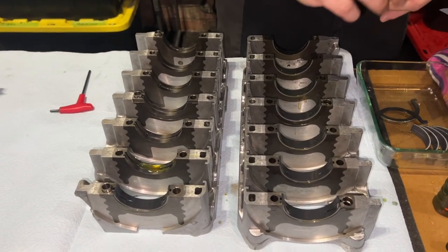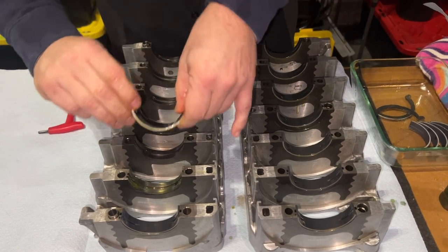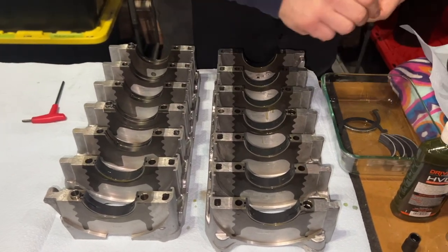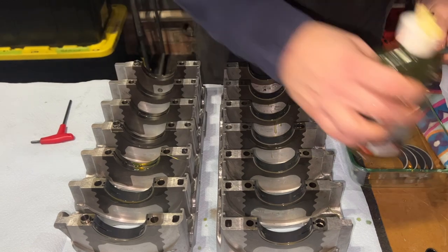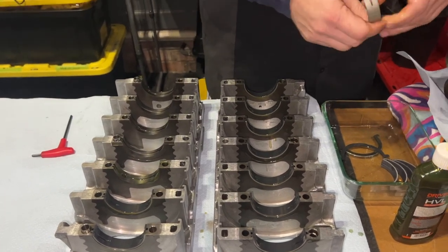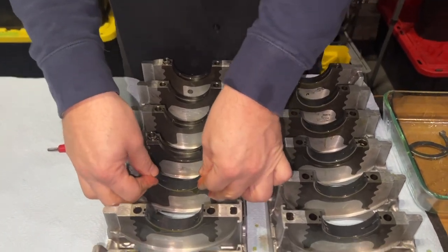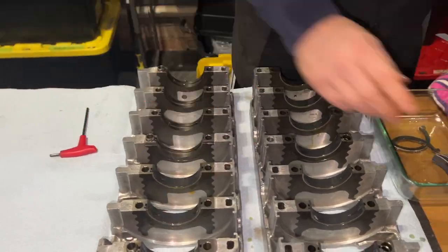Uh-huh. And these Calico coatings are supposed to make your crankshaft last, mostly in cold startups. I don't know. They use it in high performance engines. I figure for $100, I was already deep into it, right? The general advice is, it helps. It doesn't hurt, probably helps. Not a lot of data around it. The factory doesn't use it, because the factory wants to save money. If you're keeping the car, then I would do it. I won't be doing it for my engine because I'm just going to fix it and sell it. If you like it, then you will. Yeah. I will.